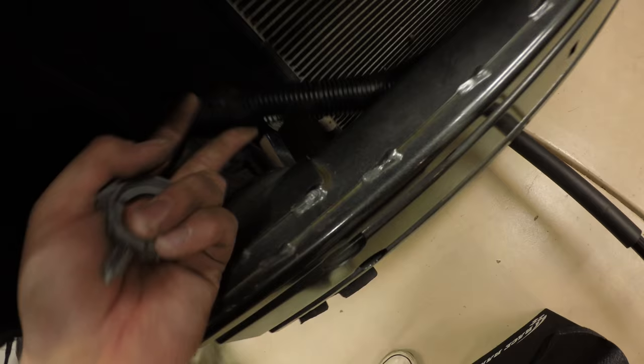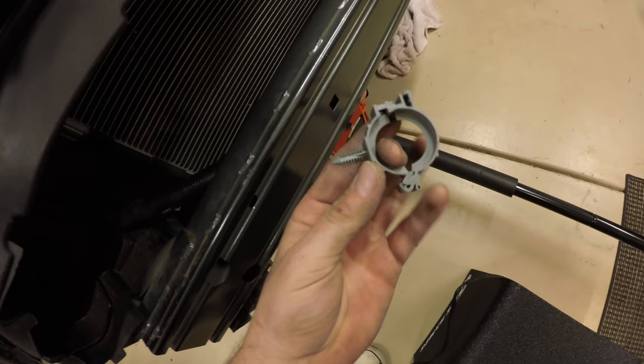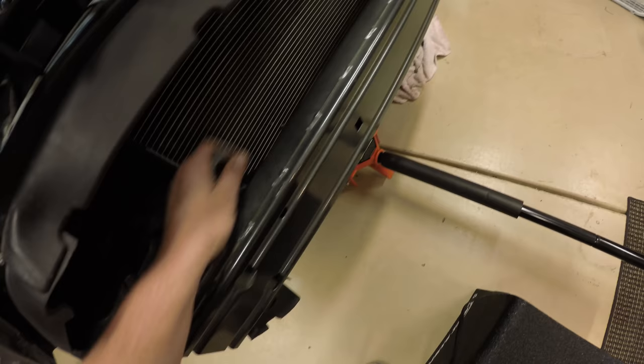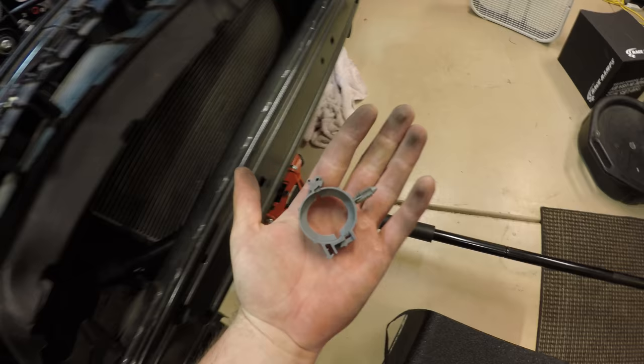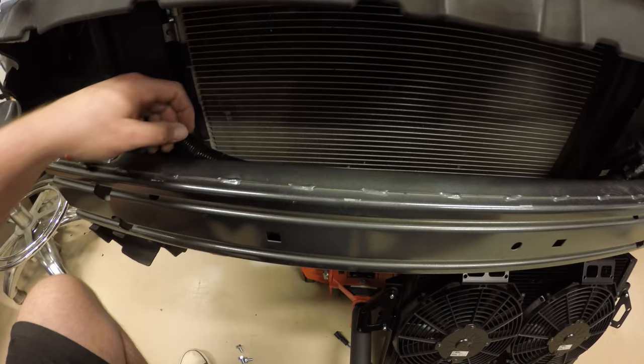Once you have these couplers screwed in, you have this factory wiring harness, and you have the factory plastic harnesses. You're gonna wanna use a pry tool and remove all of them. So factory wire harness is just gonna be hanging here. Alright, so we're about to put the heat exchanger behind the bumper, or at least the crash bumper, whatever you call it.